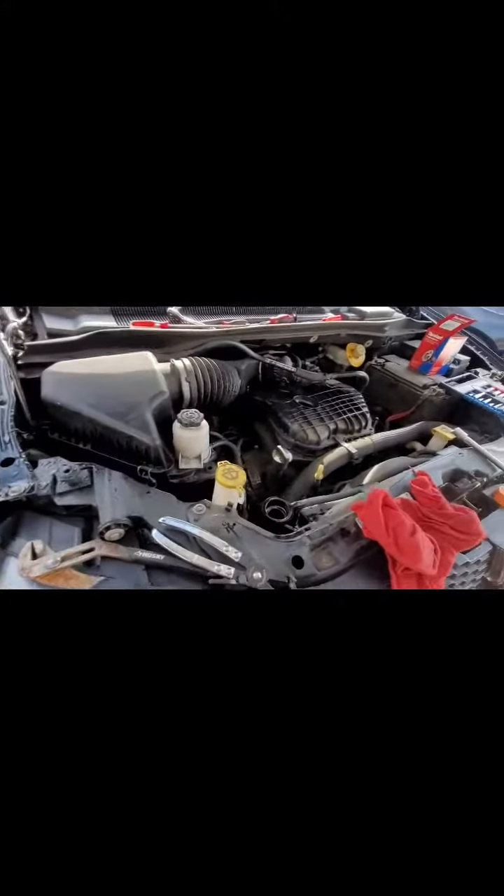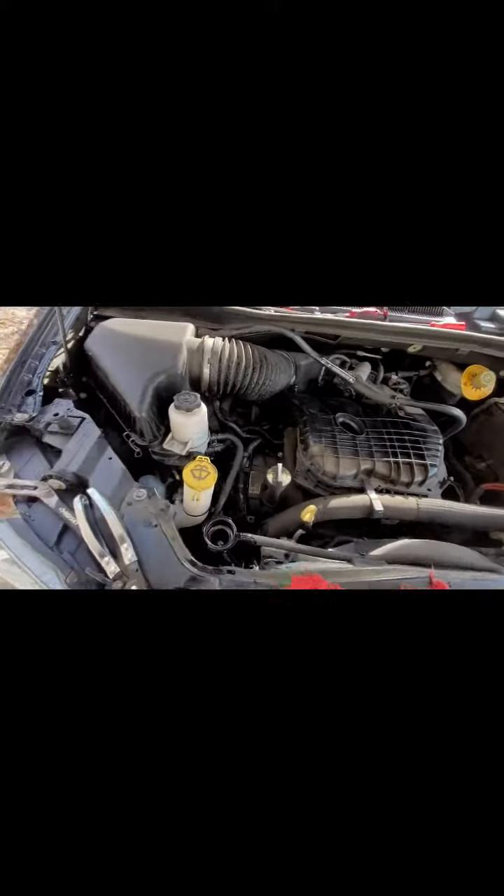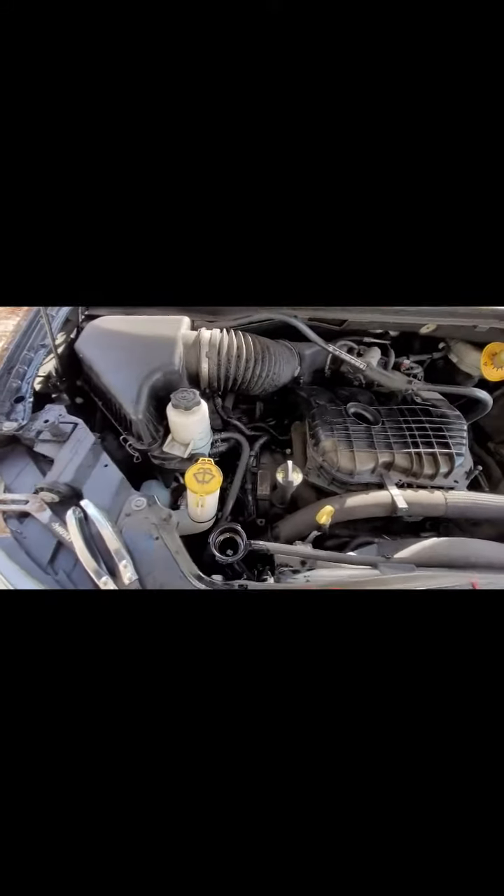The temp's going up a little bit. You'll probably hear the thermostat clicking open eventually. I want to make sure there's no leaks under here — there's going to be some dripping, like water, but if you notice, the drips I see are from the spray pattern I just did, not a real leak. I want to make sure the thermostat opens and closes properly before I wrap it up.